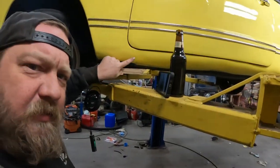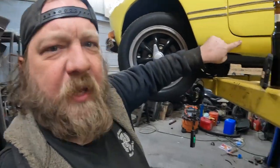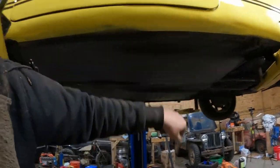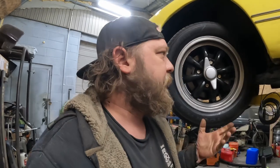I'll be right back. All right, guys, don't know how well you hear me because I got the jet heater going and I'm on the GoPro, but I got my borescope going into the fender well because in the test drive I commented about the body flexing, and well, there's signs as far as the cracks go. There should be a fender seam here and another body line here. I weld them solid and I put Bondo over them, so it's not unheard of not to see those seams, but like I said, I just don't fill them with mud.